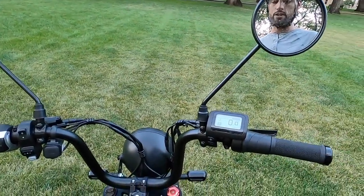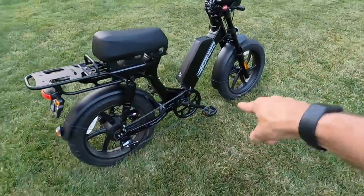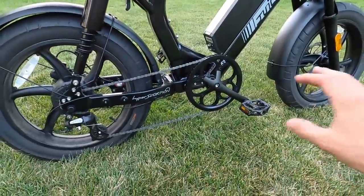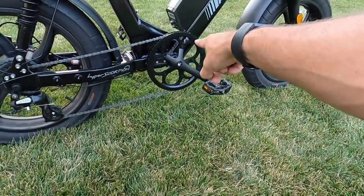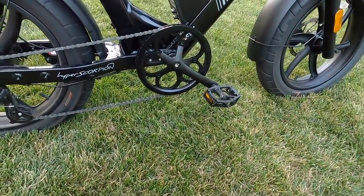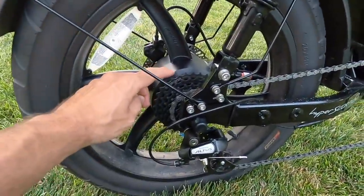Race mode lets the throttle go past 20 mph with really nice smooth power delivery. Pedal assist on this bike is a little unusual — it uses both a cadence sensor and a torque sensor, but they behave differently than on most other e-bikes; we'll talk about that during the ride test. The drivetrain has a 56-tooth steel chain ring with a double-sided alloy bash guard to keep the chain from jumping off and protect your pant legs, plus a Shimano HyperGlide 11–32 tooth 8-speed cassette in the back.